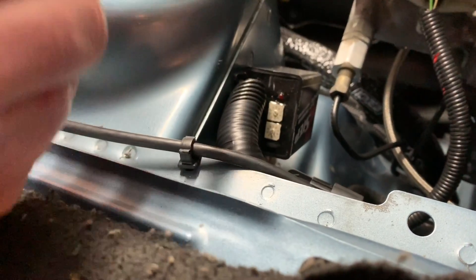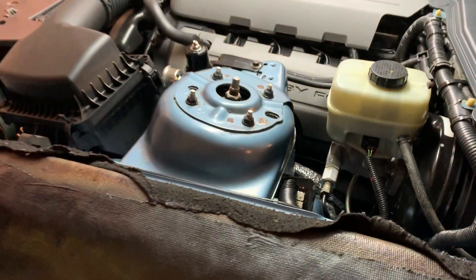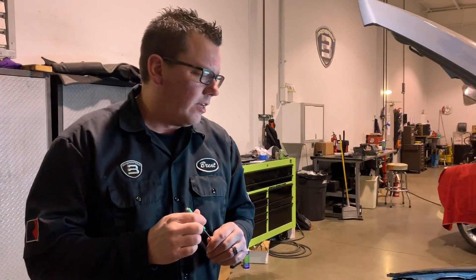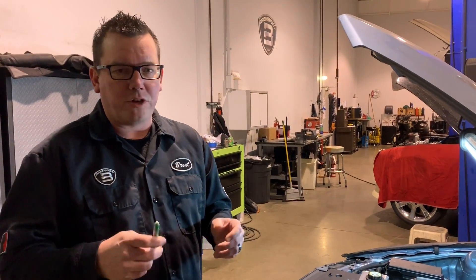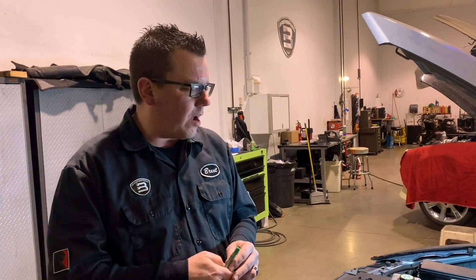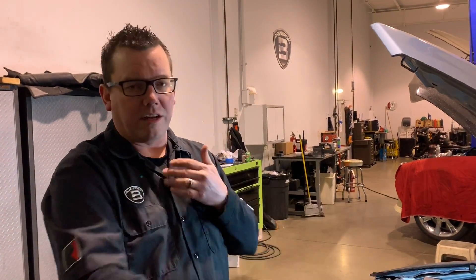So that's 6,000 plus 200 — 6,200 RPM total. When you're racing you can adjust this: do I need to go lower? 6,200 is pretty high. I have high hopes this car will dead-hook. It depends on the track — some crappy tracks won't hook well, but good prep tracks like the NMRA series the car will dead-hook to where you could break something. You just tweak it with a screwdriver, hammer it, the RPMs hold right where you want, then you release the clutch.